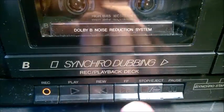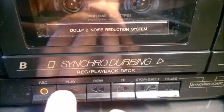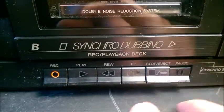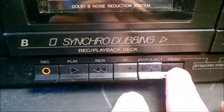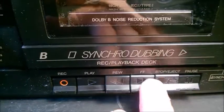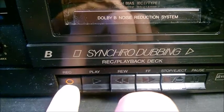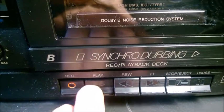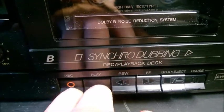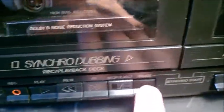You can actually use this same technique if you have a double-decker like this one. Press the pause button, keep it down — it stays — then rec and play at the same time. If you press rec on its own, it will usually depress the play button automatically, but it's better not to force the mechanism. That's why I like to put my finger on both of them at the same time.